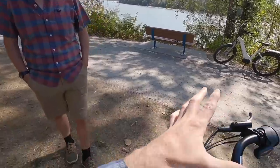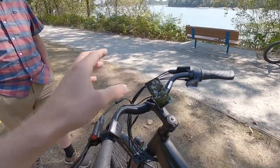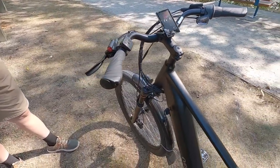There is an optional throttle you could potentially add to this bike, but it ships as a Class 3, just a speed pedelec. Top speed is 28 mph out of the box, and it's throttle capable — pre-wired. You can add the throttle, but keep in mind that's for off-road use only, because at that point it's no longer legally used on the road. In the future there may be more speed adjustments available via the display. There's also a USB charging port at the base of the display, so you could maintain your phone or add additional lights.